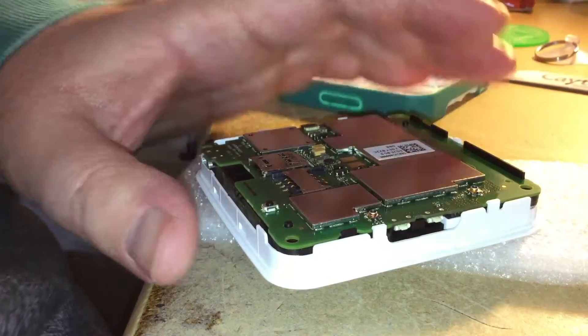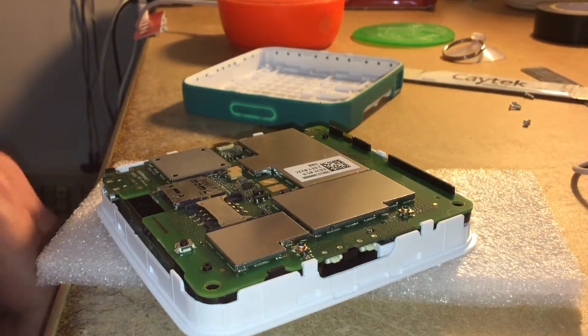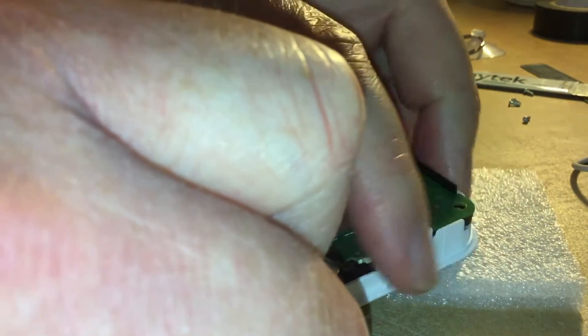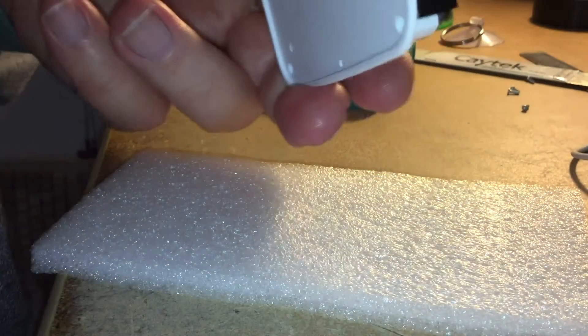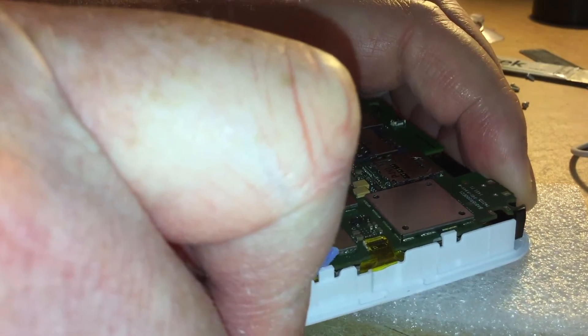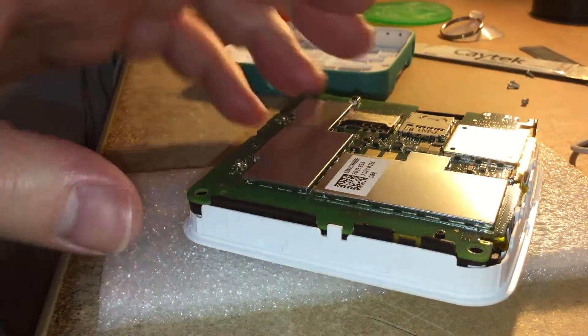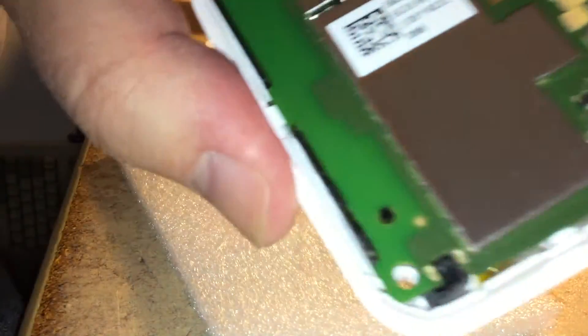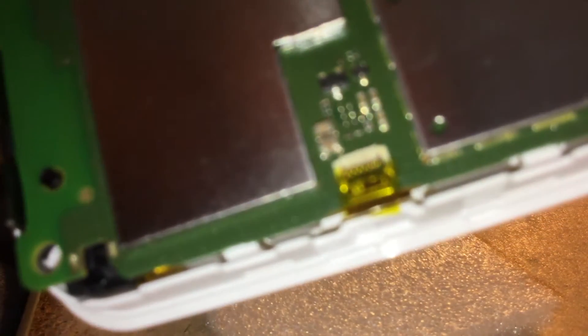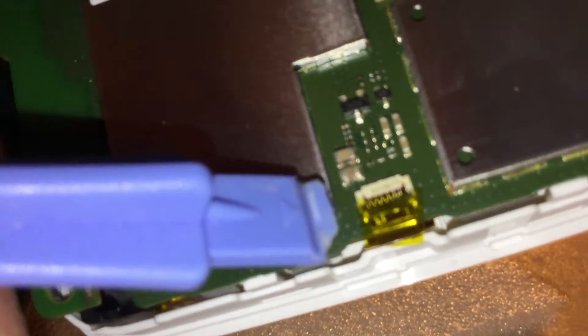Put the camera down a bit so you can see it. There are two on two sides, two each on two of the parallel sides, and there's another one there. Lift that up, but don't pull it up yet because there's a ribbon cable just there — excuse me — a ribbon cable under a connector, and that's for the AMOLED. So get my trusty tweezers and I'll zoom in a bit so you can see what I'm doing.